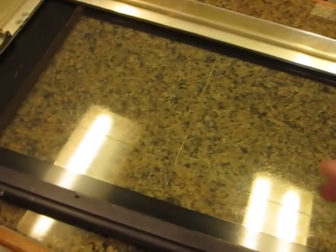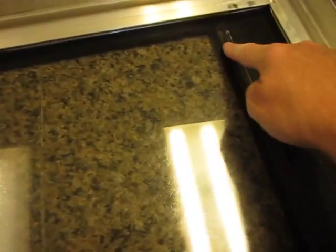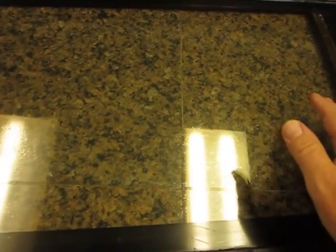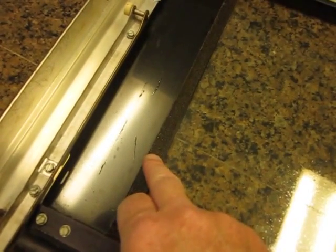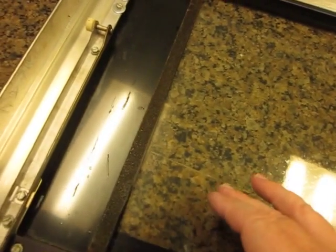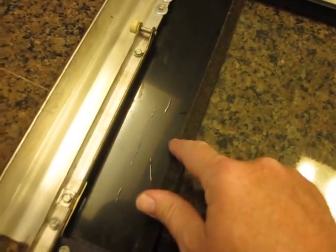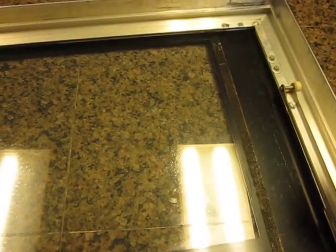With the plastic title holder strips out, I was able to get down to the glass and clean the back side — it was pretty grody. One thing to mention: on both sides is a piece of double-sided tape that used to have a piece of foam on top. That was a cushion for where the title strip holder plastic sat, and it also kept light from leaking in from the sides — more of an aesthetic thing as well as a little sound barrier. This plastic totally disintegrates over time into little brown stuff, and it was everywhere in here. You cannot peel this off — if you peel it off, it's going to tear some of the paint off as well. Unless you want to repaint the black, just leave it on there. Clean this while you have it apart, and be very careful of the sharp edges.